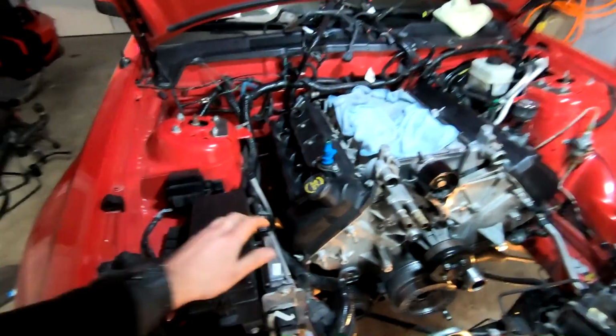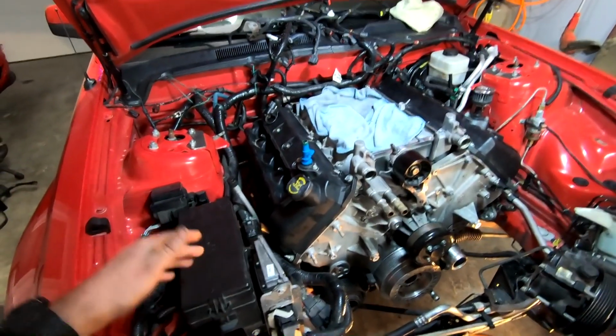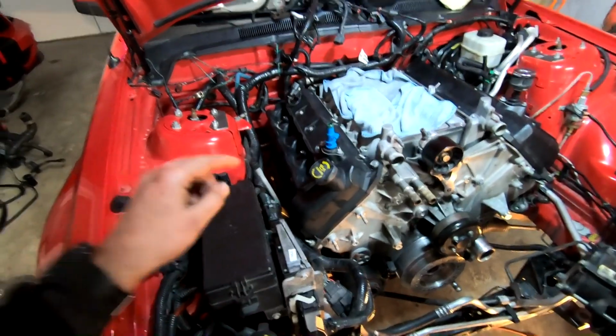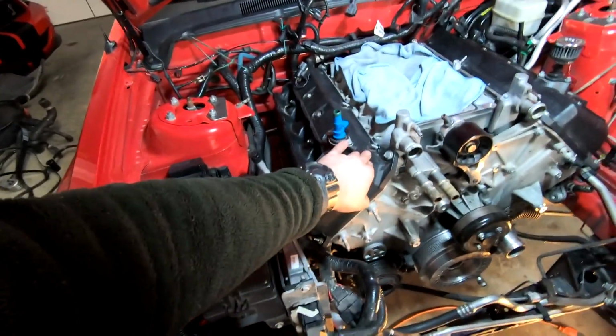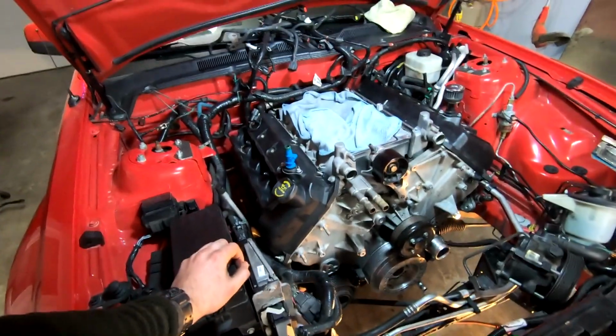All right, just put in our motor mounts, and those are called motor insulator bolts. But they go from the mounts to the insulators, I guess, whatever you want to call it. 46 foot-pounds for both sides, so we did that. Got all these guys at 89 inch-pounds that run around here, got little sensors on. So we're coming together, for sure.